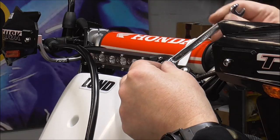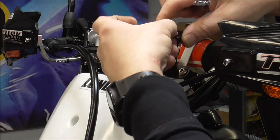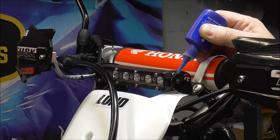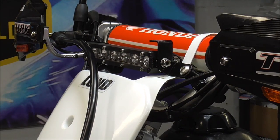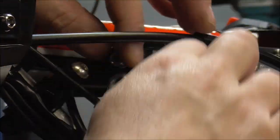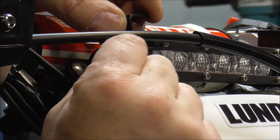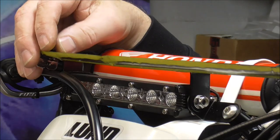The first thing I want to do is get started on that bracket. I'll start by loosening up the existing lock nut. The bolt isn't quite long enough using that lock washer, so I'll put some thread locker on it and use the flat washer instead. I was able to get that side — let me move over to the other side and do that one. Then I'll take that piece of aluminum, cut it to length, put some holes in it, drill it, and do some fasteners.